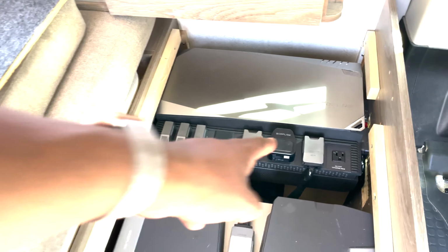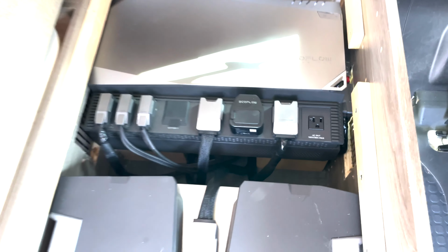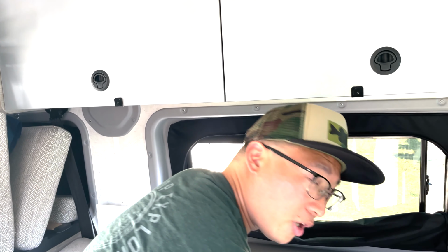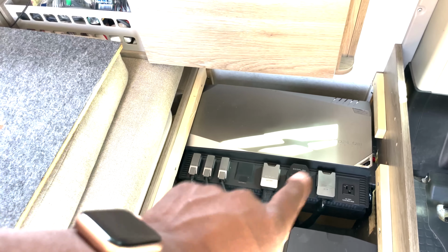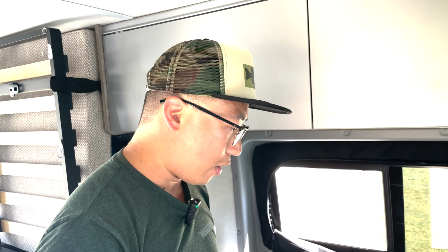Gotcha. All right, but I see here you have an AC in. Now, where does that connect to? That AC in usually connects to the power inlet of all the RVs. So shore power. Shore power, right? So every RV has a shore power inlet. It can be either 30 amp or 50 amp. Okay. Because the power hub is 30 amp. So this AC in is a 30 amp input port that can take up to 3,000 watts of shore power charge. Okay, so that's interesting, and this is 120 volt only, right? It's not 240 volt yet. No, not yet. I mean 240 volt, you've got to do it in split phase. You can do it eventually. You'll do split phase with this? Eventually, yes. So we're going to make it parallel. So you can put two power hubs in parallel to make it 240.